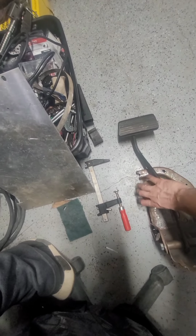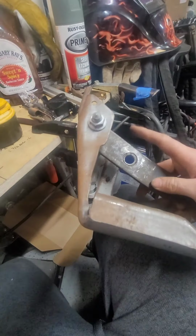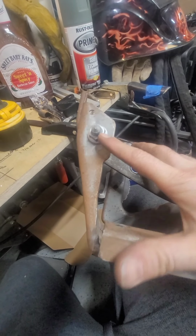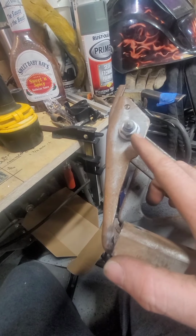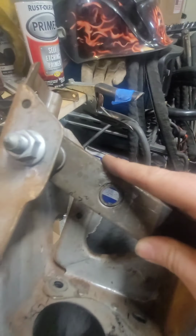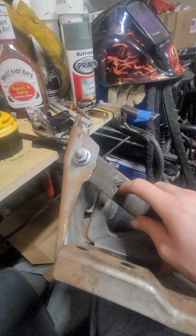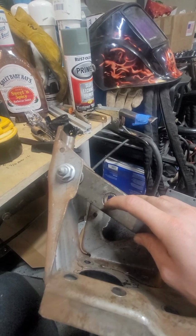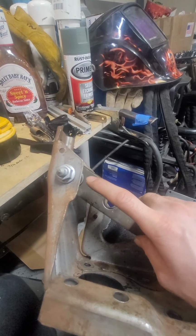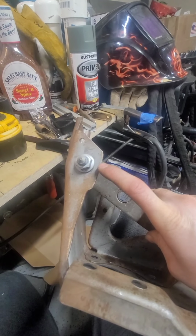Then over here, this is the one from the Duramax. I kind of butchered it up so that I could take my measurements. The height from the wall to the nut, or the rotation, is different than on the Humvee. That makes the stroke of the brake booster and all that stuff different. And it's also pushed forward, I think, 3/8 of an inch more.